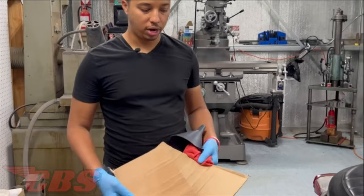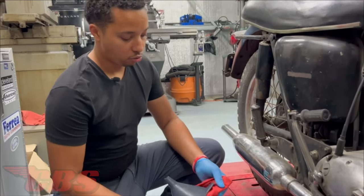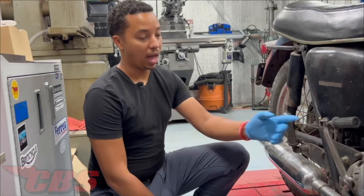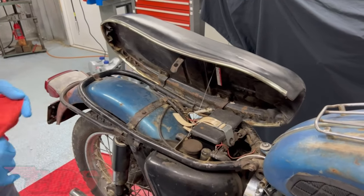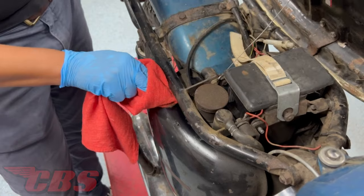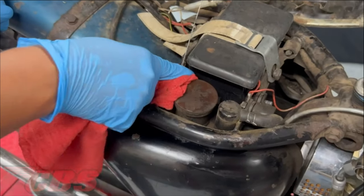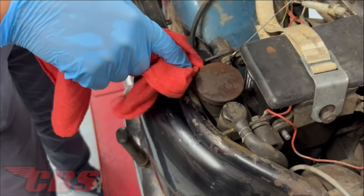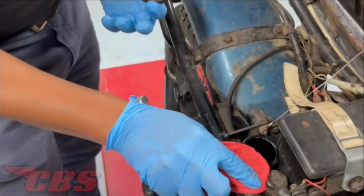This is some preparation before the oil change. I got some cardboard here — I'm going to throw it down to keep oil off the ramp, one less thing to clean afterward. We got a rag and our funnel. We're going to open up the seat and I'll show you underneath — a few things you can do before you put oil in and remove oil from the oil tank. It might be a little surprising that it's really dirty under here, but this is a pretty original bike and it actually runs pretty good. We're going to clean up all the debris around here — a little bit of oil, a little bit of dirt. You want to clean everything up around the filler neck to make sure no debris falls inside the oil tank. Once we feel comfortable it's clean, we can remove the cap and clean all the way underneath.